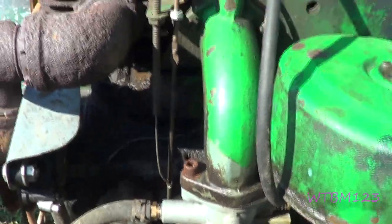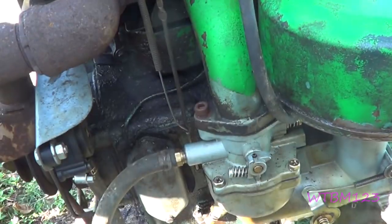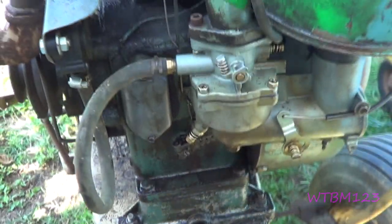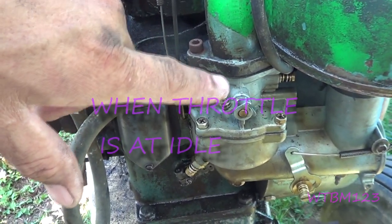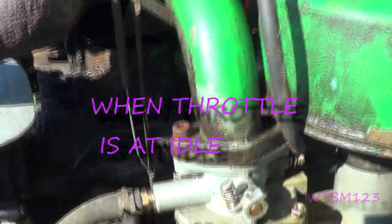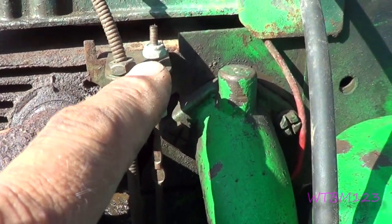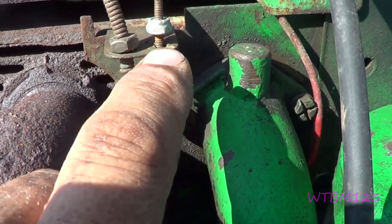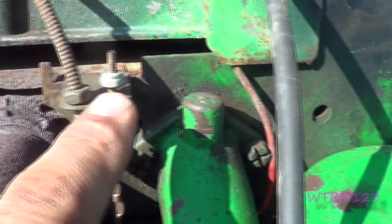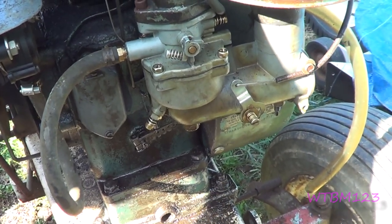When you open the throttle up — see how this comes up. A lot of times people try to adjust and this is up in the air like that. And usually if that's up in the air, you go right up here. That nut's sticking up in the air now. But just say if that nut was all the way down onto this piece of metal, it wouldn't go all the way closed. You would loosen this top nut. The idea is that whenever you let off the throttle, see how that went closed.